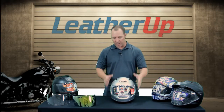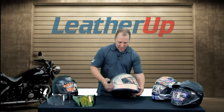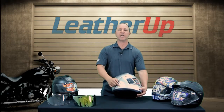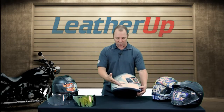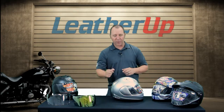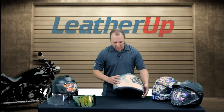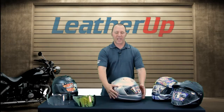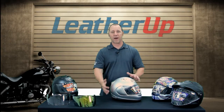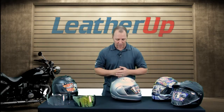Using a nice smooth outer shell also allows energy to radiate across the shell. The only ridges are at the earpiece where the pod system is, across the top of the visor, and a hyper ridge at the bottom. That hyper ridge adds rigidity to the shell. In the event of an accident, if a fracture occurs it will typically happen at the point of impact, and if large enough it will stop at a ridge. So we want that energy to travel from one side of the helmet to the other because it dissipates as it moves and doesn't focus the impact on you.